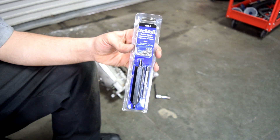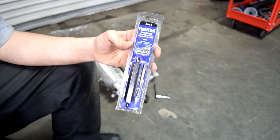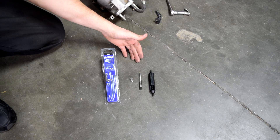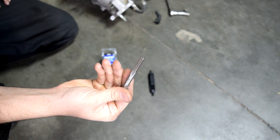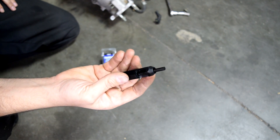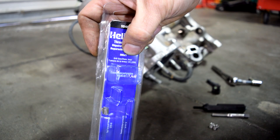I think only O'Reilly's or maybe NAPA carries these kits, but if you have time you can buy them online — I'll put a link to some common repair kits in the description box. Here's a look at the contents of the repair kit: you've got your thread inserts, your tap, and your thread insert installation tool. Next, we need to drill into the hole where the bolt goes, and the size of the drill bit you need is usually written on the box — we're going to use a quarter inch drill bit.